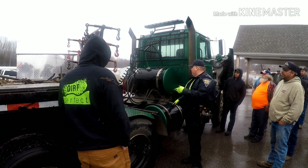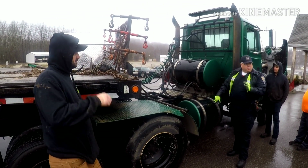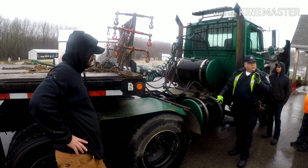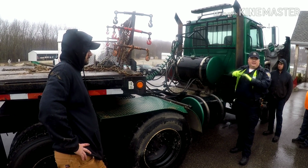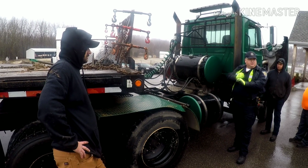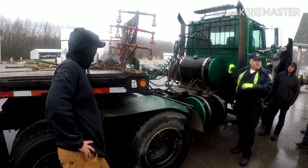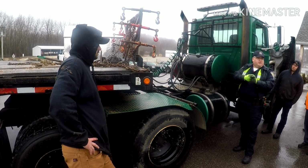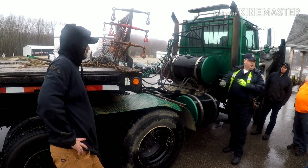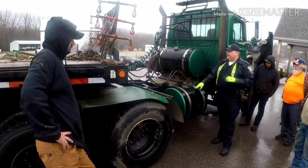We got our spring guards on there. Spring guards are really important on these, especially the red and blue lines, those thermoplastic lines, because those are real prone to kinking, and they are required springs. So if you ever have one go bad and you have to cut it off, make sure you maintain that spring on there. Too many times they'll cut it off, pull that spring off because they need some more of that straight section. They put it all back together. Two minutes later, it's kinked, and now they're still out of service.